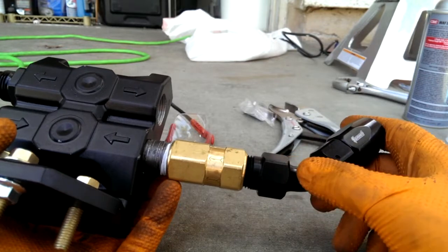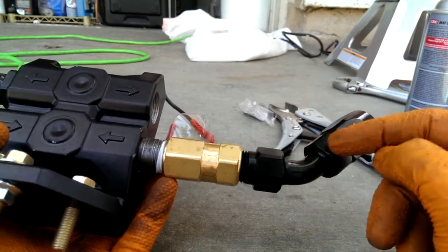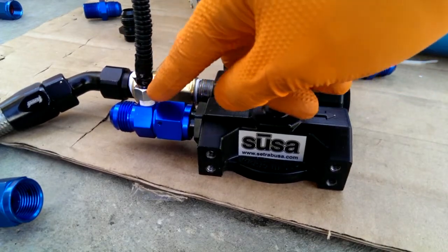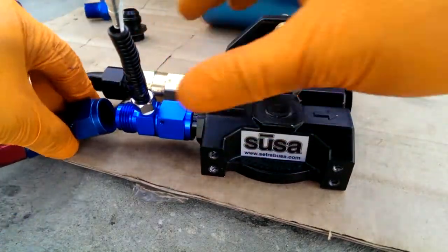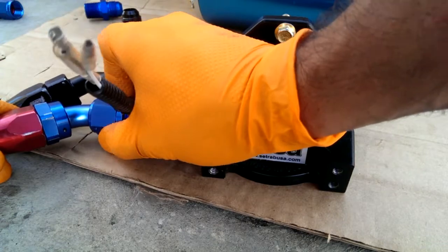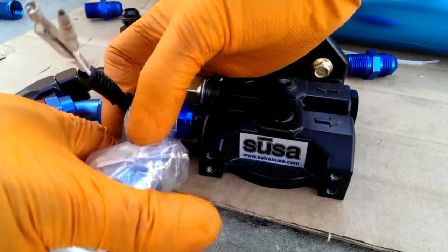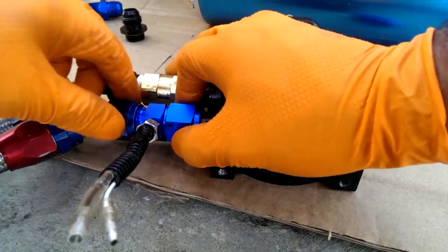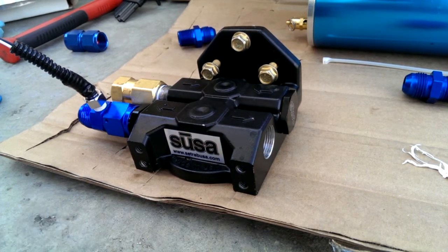Check valve — and you're going to need to order one of these: a half inch NPT male to a 45 degree bend and then a 10 AN hose fitting. We've got pressure line here, return line, and the adapter for the sender. I'll leave them loose for now and tighten them once they're under the car. The other thing I did was I put a little ziplock bag around the ends to make it easy to feed them through the chassis without getting any debris in the lines.